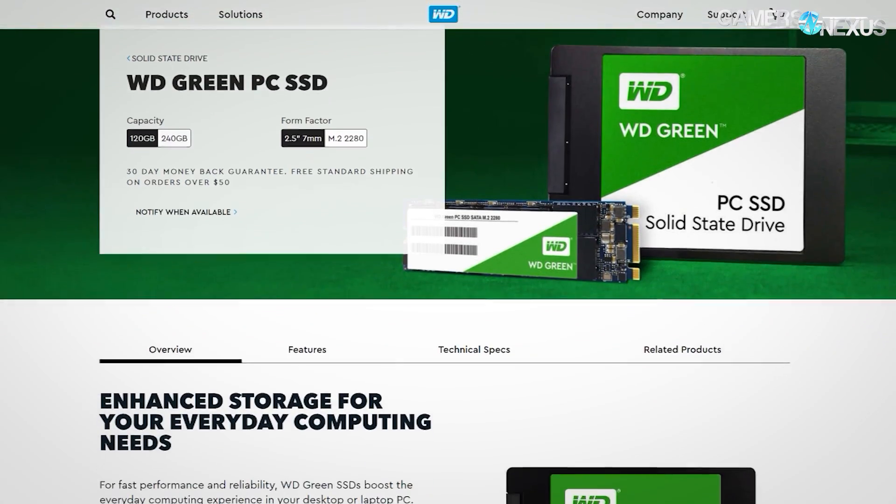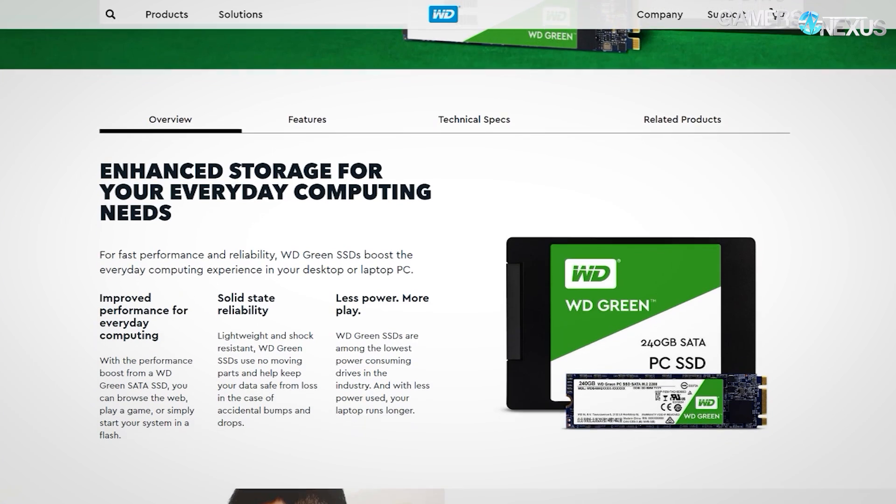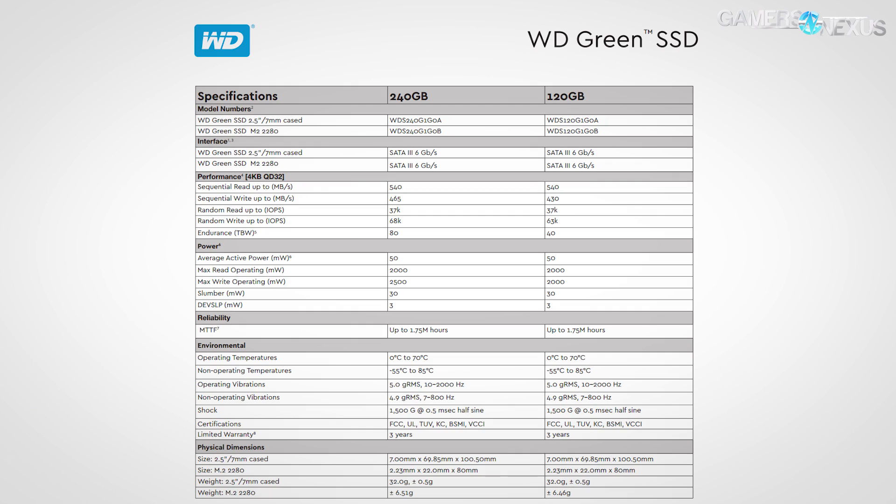The pricing of WD Purple is comparable to others in WD's lineup, with 4TB priced at $135. Moving on to Western Digital's SSDs, we see a parallel arrangement of drive colors to the hard drive counterparts: Green is the low end, Blue is the mainstream market, and Black is the performance tier. WD Green SSDs start at about $75 for 240GB. The WD Green SSD is a DRAM-less configuration on 15nm TLC NAND supported by SMI controllers, rated for only 37,000 IOPS 4K read and 63,000 4K write — significantly slower than most competition and falling into WD's weak point of price positioning versus performance in this heavily saturated market.